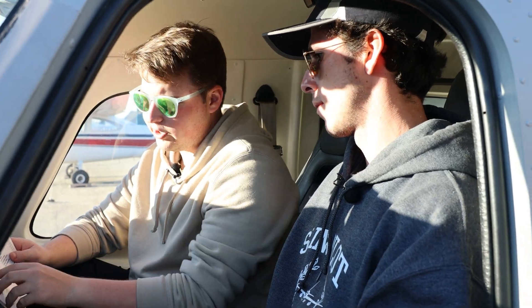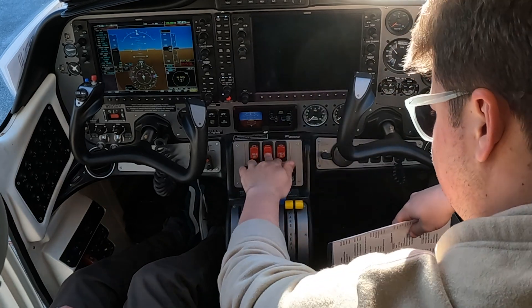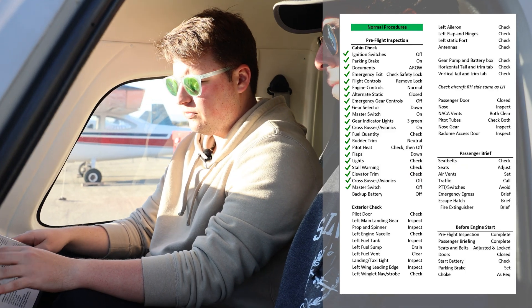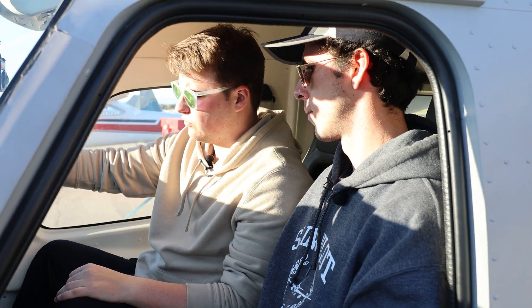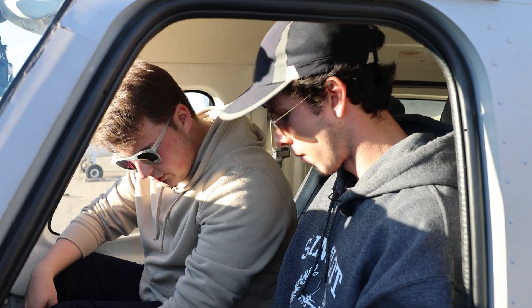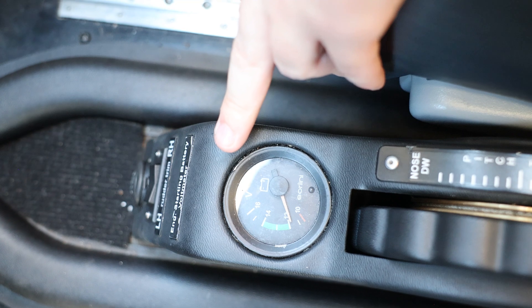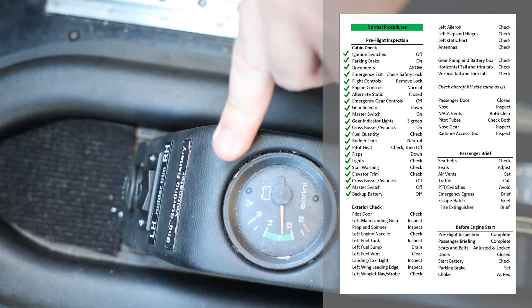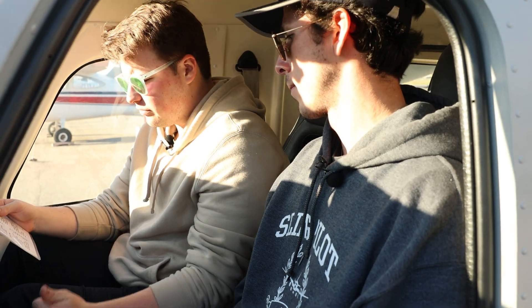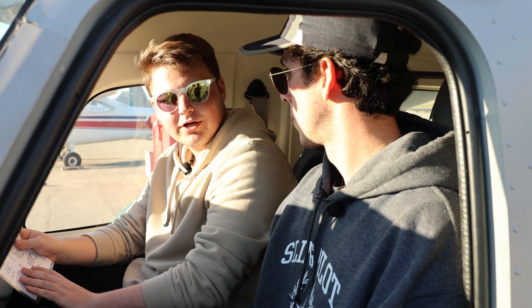Next, we're going to start shutting down — avionics and cross buses we can turn off. And last, master switch is off. So that's all checked. The last thing I like to check before walking outside is our backup battery, located down here between us. To test it, simply press down that button. As long as our needle ends up in the green, we have the power that we need. Battery checked, everything's all set, we've followed our checklist, everything is off — we're going to hop out of the plane and start our exterior check.